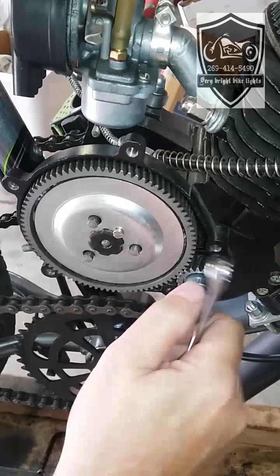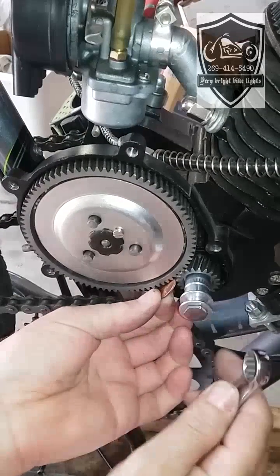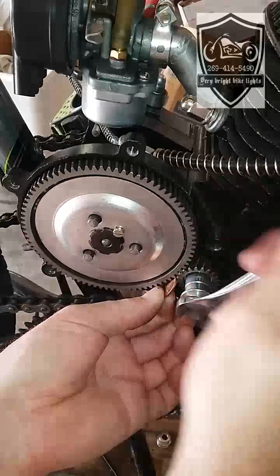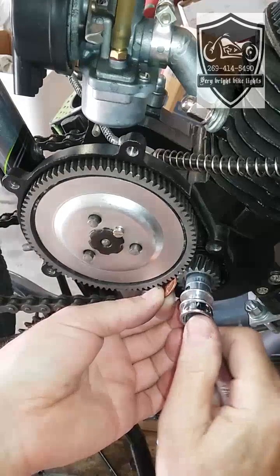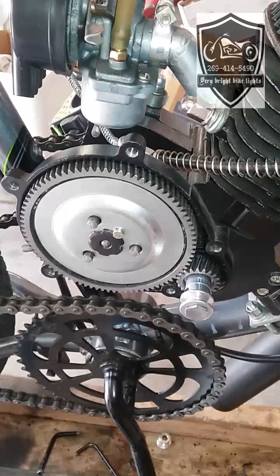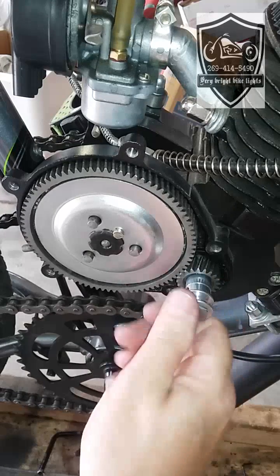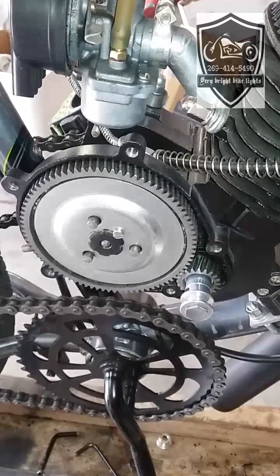You can see how those gears want to turn — you can hold them for a little bit, but eventually you're going to have to take the penny and jam it in there and finish tightening this down. I would also recommend using a little bit of Loctite on here. That's how it's supposed to look. Loctite blue or Loctite red — whatever your preference — you're not going to put enough pressure on this from the belt drive to the alternator to turn it out, but better safe than sorry. If anything, I would put a little bit of Loctite red on that bolt before putting it in.